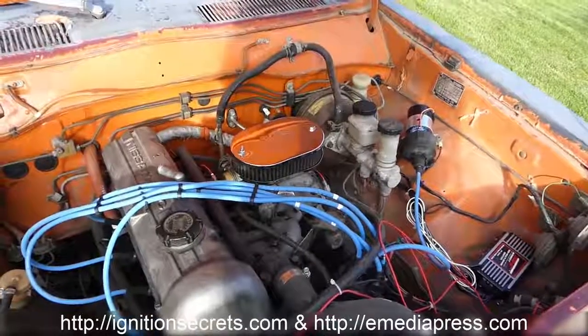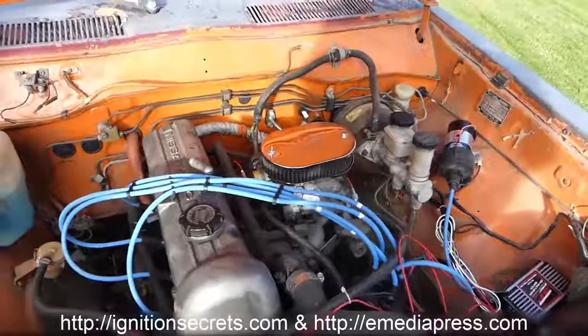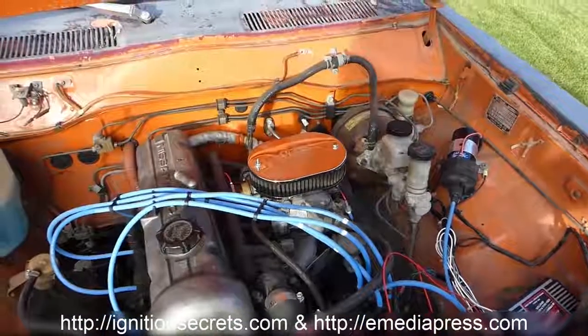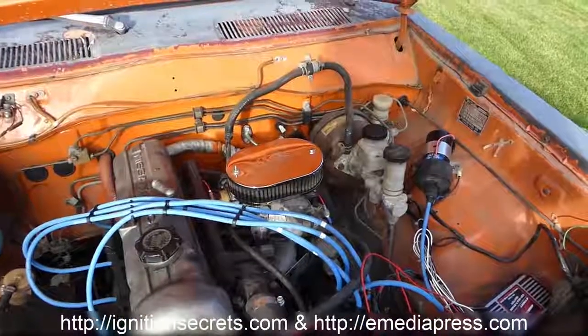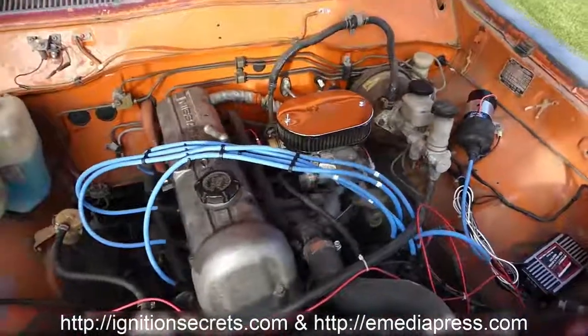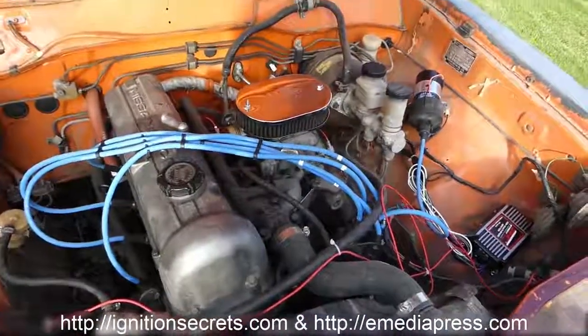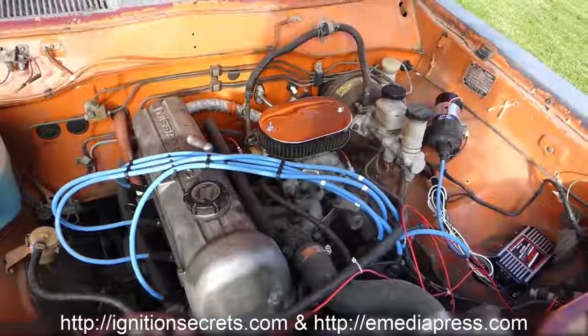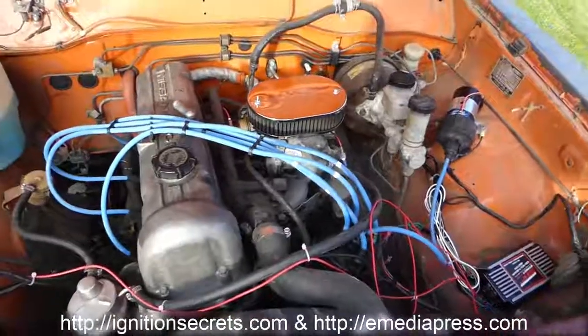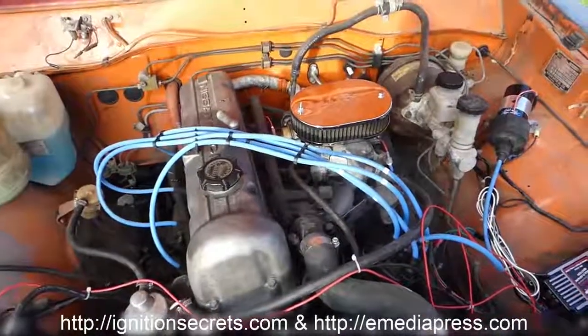And so you're getting more power out of the same amount of fuel, or you can go in the opposite direction of leaning it out, and you are able to thoroughly combust an ultra lean mixture, because the plasma ignition and hydrogen can extend the lean burn limit, which means you can go to 20 to 1, 25, 30 to 1, and you can actually experience a temperature drop of over 100 degrees on an engine, which is quite contrary to the claim that you're always going to have overheating.